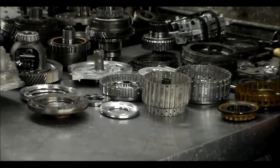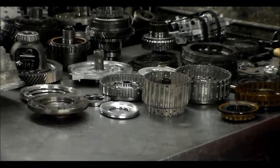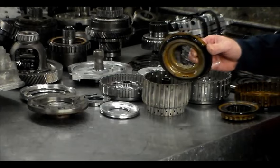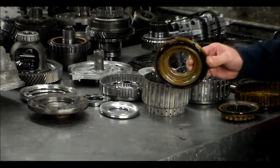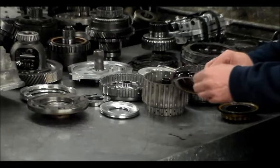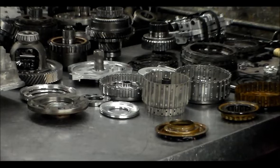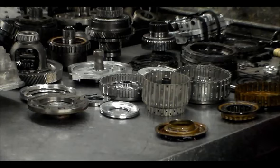So I guess we'll just see what's going to happen when I get the parts and put this back together. It's not a bad unit to do, it's fairly simple. But I'm just waiting on parts, that's really about it. So I guess that's about it for this 2010 Kia Forte. Again, we found this piston, no good. The bonding looked like it was coming off here on this, and as a result, P0733. After it attempted to shift, it would just run away in third, boom, hit failsafe, and the code would appear.